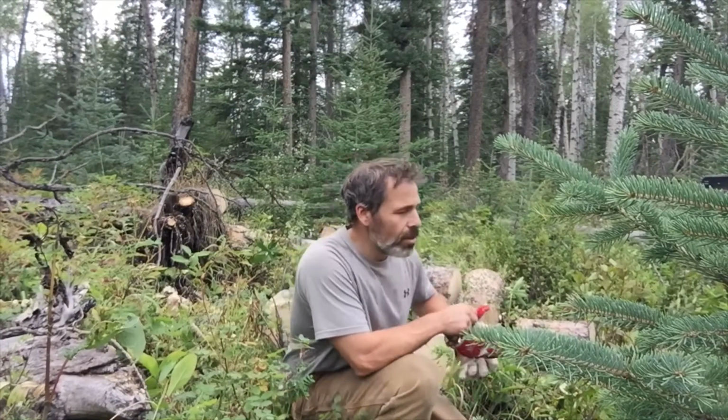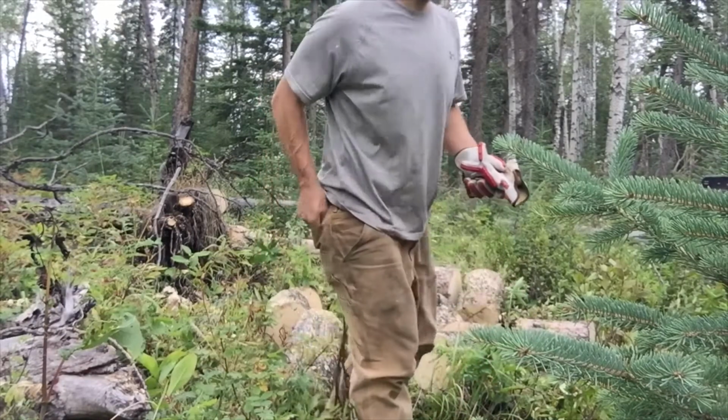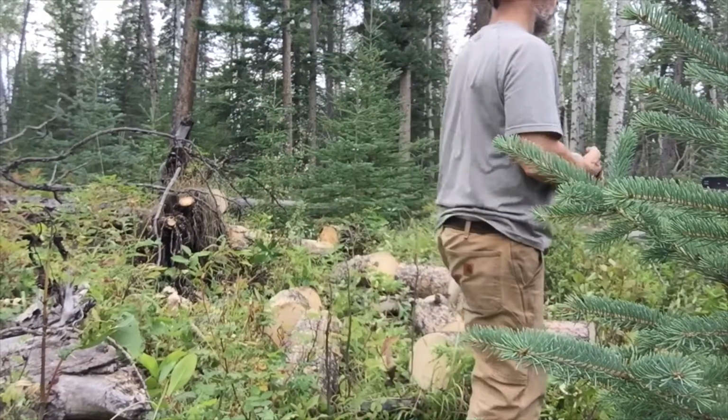Sometimes when you muffler mod them, they like to lean out after you're cutting. They'll kind of lean out on you a bit. So I don't know if it's that or what, or if it is that diaphragm. Anyway, let's see if we can do a hot start on this thing. It's a McCulloch.